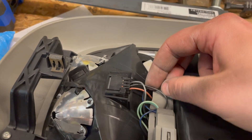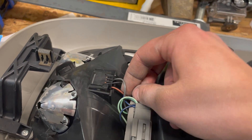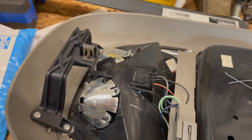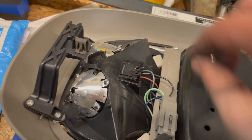We're going to look at the top of the lights. I'm just going to guess here, but it looks like I've got a ground, power for one side, and power for the other side, because they go from the little switches. I'd like to have all that still work, so I'm going to wire one power here, one power here, and both grounds to this.